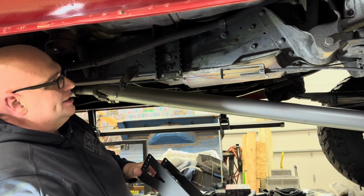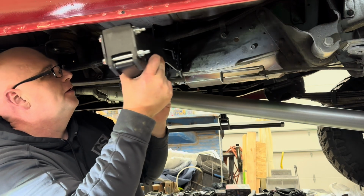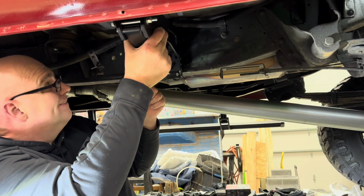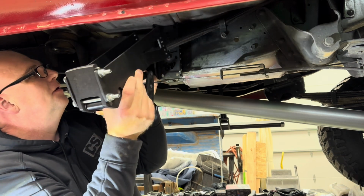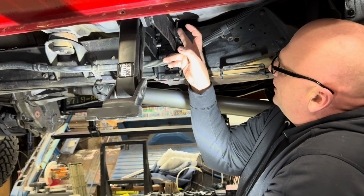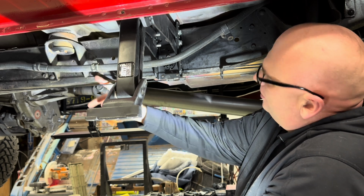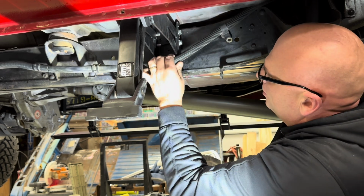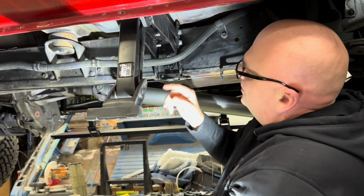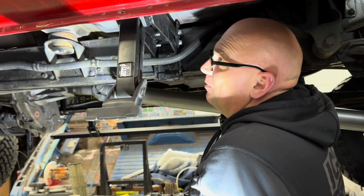And the nice thing about our kit is you can adjust this up and down a little bit to put it where you want. I think we're gonna have to go under on this wire. Okay, so after all that, we actually ended up in the second hole down here, top hole in this bracket. We're gonna go ahead and re-secure the wiring harness. This is gonna be right there. It looks like it's gonna be okay to me though. Okay, and this is clear. The wiring harness is in a good spot, and this e-brake cable is in a good spot.